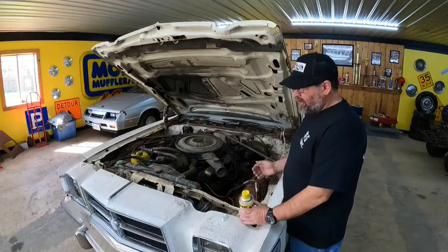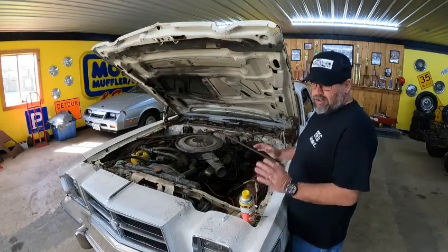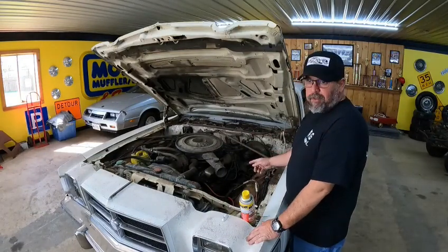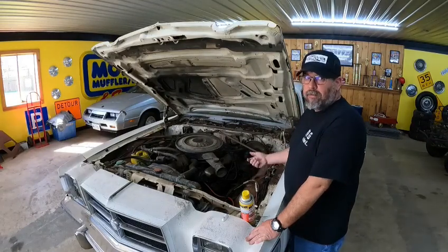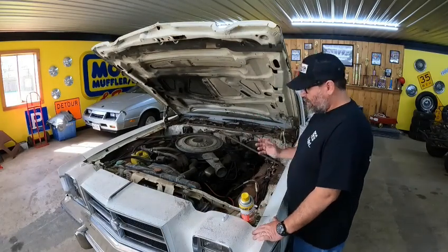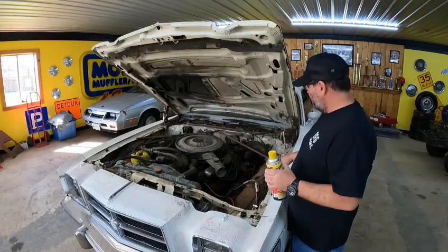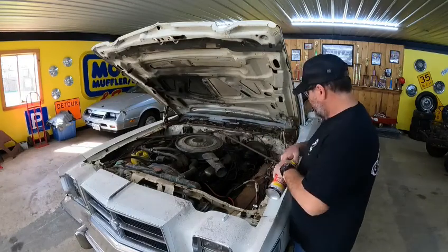Because we've all been there, you're like, snap. And then you're sitting there trying to tap it out. It's just an absolute nightmare. So I'm gonna keep soaking these with some PB Blaster. And then right before we take them off, I'm gonna throw some heat on them and nice and easy get them bolts off there. And then we'll see if we can get our new headers on. So I'm gonna soak these down and then we'll start taking some of this crap off and start trying to make all the repairs.